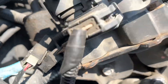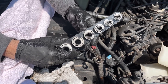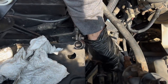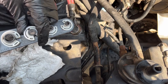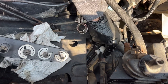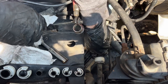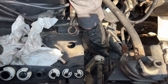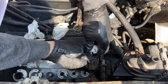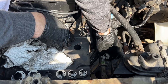You're going to need a set of these AC line disconnect tools to be able to disconnect the air conditioning lines. Now that everything is fairly loose, down at the intake and exit of the condenser we're going to use these tools to pop those connections off. You find the right size, pop it on like this, engage the little collar, and you can see how it disconnects the spring so you can pull the line open. Be sure to release the pressure in the system if there is any — we had very little pressure. That's all there is to disconnecting the AC lines.